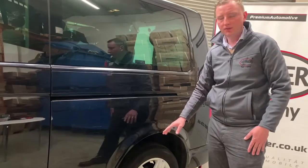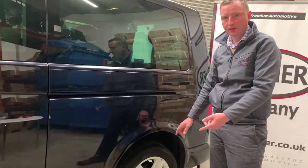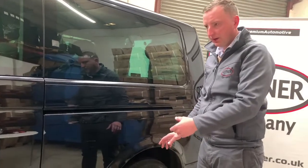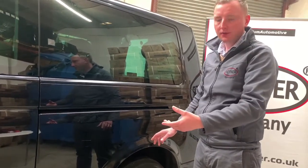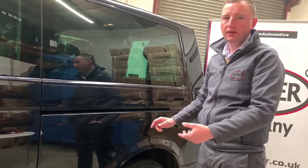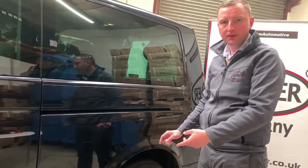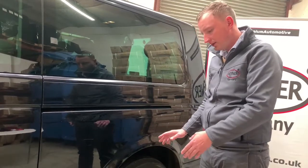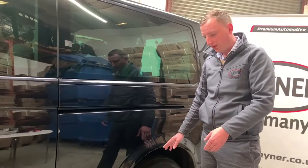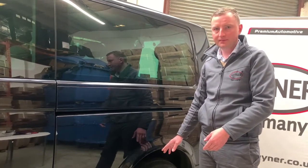The engine was off. If you want to boost the compressor, the power depends on your battery. So when the engine is off, it takes all the power from the battery. You can turn the engine on and that will boost the speed of the compressor. So as you can see, it's no problem for this compressor to pump quite a big tire from flat to 35 psi.